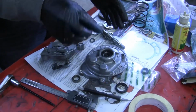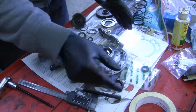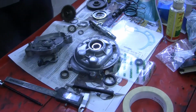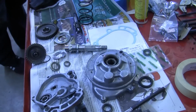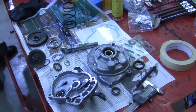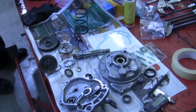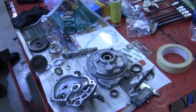So on the smaller sizes, it becomes more important to get the correct screwdriver for the JIS standard, but for the larger number three size, or whatever the JIS equivalent number is, it's less important simply because the difference in the actual geometry doesn't cause it to cam out. So a Phillips head screw was originally developed by the Ford Corporation for the production line of the Model A or the Model T, I don't remember exactly off the top of my head, but they were designed so that when you applied a certain amount of torque to the screw, it cams out, which forces the screwdriver head outward, which is why there are little concave radiuses inside of it that force it out, which is why Phillips head screws are actually pretty easy to strip out, because they're designed to do that.